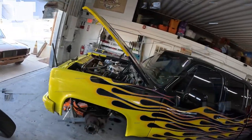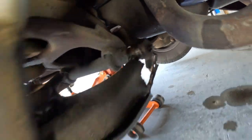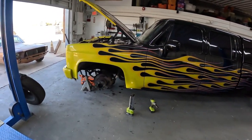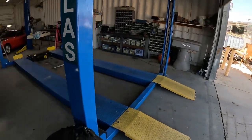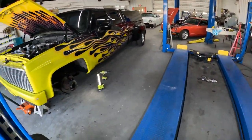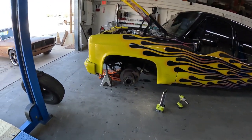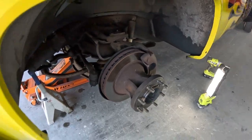If you didn't see any of the previous videos, my lower control arm broke and I knew it was a problem and I have the parts to swap it out. But I'm going to be getting rid of those and putting some 24-inch 10-lug semi wheels on. And my plan for that is getting rid of the C30 suspension pieces and putting C20 suspension pieces on. And I already have that stuff.